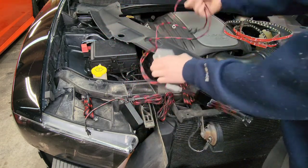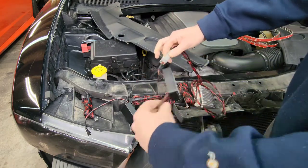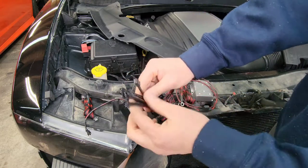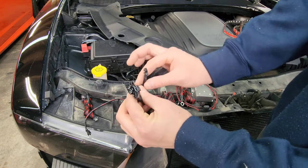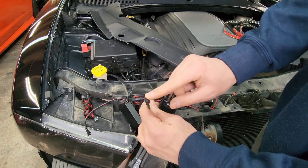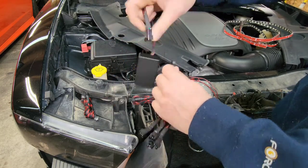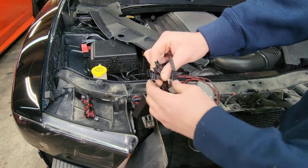And you follow this guy to this guy right here. This guy plugs into your power source. And then you have your leads for all of your light strips. And then you do have a fifth wire. This fifth wire is a female end. And that's going to get plugged into your Bluetooth controller right here. Just like that, and then you have your feeds for the light strips.